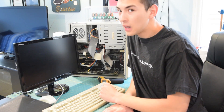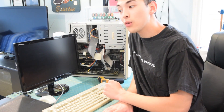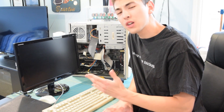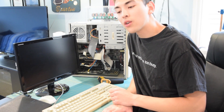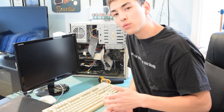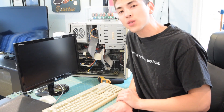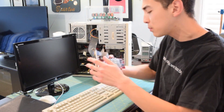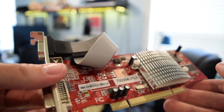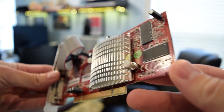I was messing around with DSL and Puppy Linux all last night and I have some good news and bad news. The good news is that it appears the system is capable of booting off a USB flash drive using Plop, even with that VIA card — not sure if that's causing any problems since I don't have a different card to compare. The bad news is that Xorg and Xvesa don't really get along with this Number Nine video card. I did try to swap the Number Nine out with a Radeon 7000, but the system would not even POST with that card installed.